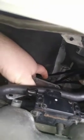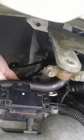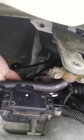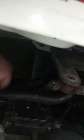Now you also had to take this plate and all if you're going to change your plugs. At least with my experience, I had to pull the coils and all off of this heatsink in order to get my coils out. Now it might not be in your case, I'm not sure, but depending on the year. Let's see, get this thing back in here. Anyway, she sits in there just like that. Like I said, those two studs, it just wraps around and sits down on there.